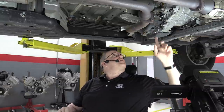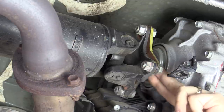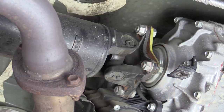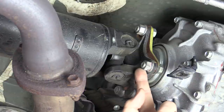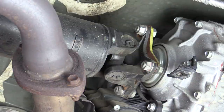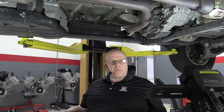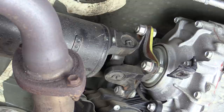The next flange that bolts to the companion flange is called the flange yoke. The flange yoke has ears — just like any other yoke — that the U-joints are pressed into. This particular flange yoke has external snap rings. Inspect it for any type of damage: whether it's been hit, subjected to improper service, looks bent, or struck with a hammer. Make sure it's in good shape. Moving to the rear of the driveshaft, there's another companion flange that bolts to the pinion gear of the rear differential — inspect it for damage and make sure all the bolts, nuts, and washers are the same.